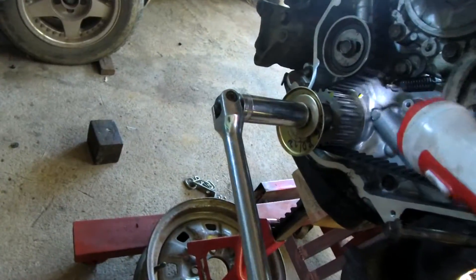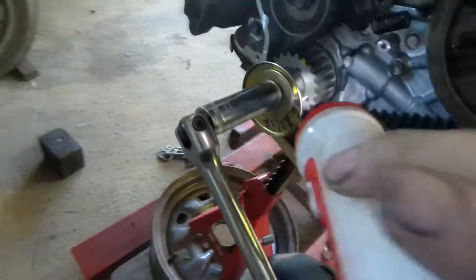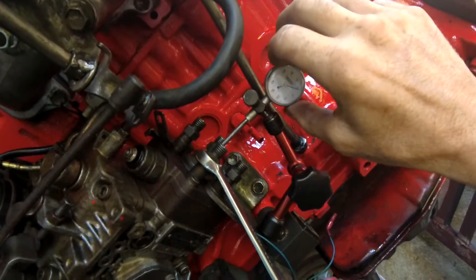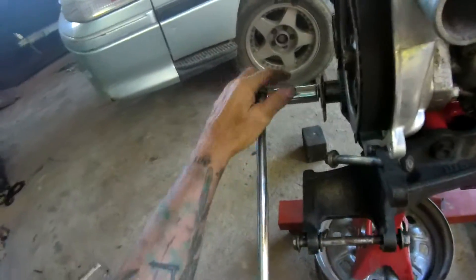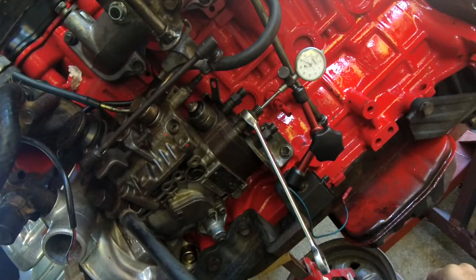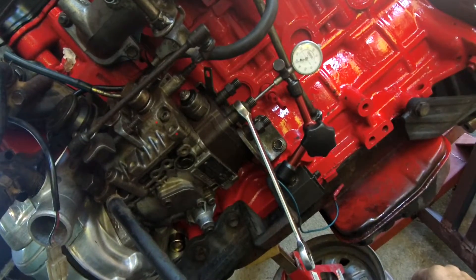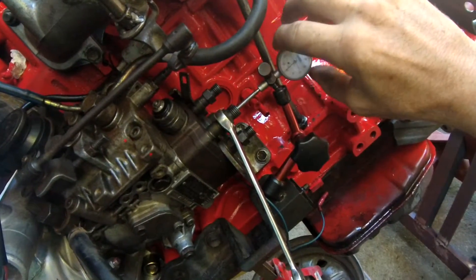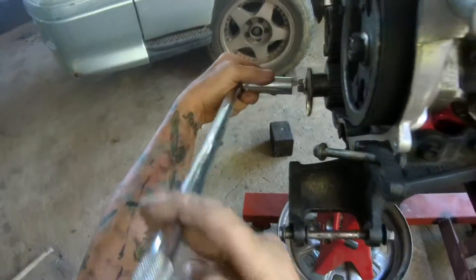For those of you that like seeing things twice: first, set your engine up to TDC, establish a starting point, then wind your engine back from TDC very carefully. What's happening now is the plunger is going back down inside the pump. Right, stop there - we're going to zero that. That's the starting point.